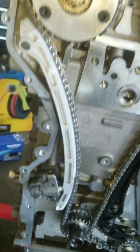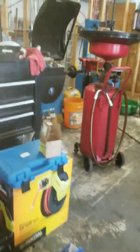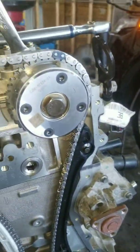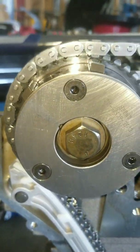Let's install it. The fan is on, so now it's time to tighten this one and this one — but first pull out the tensioner pin. Save it for next time. When it's done you need to hold it here, put a 24mm, and this one is 75 Newton-meters. That one requires a little angle job. This one — 75 Newton-meters, and also 75 Newton-meters.